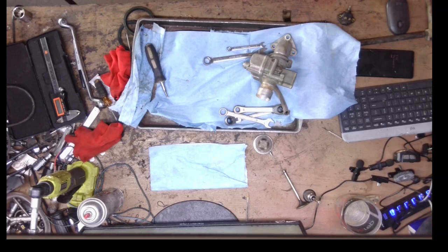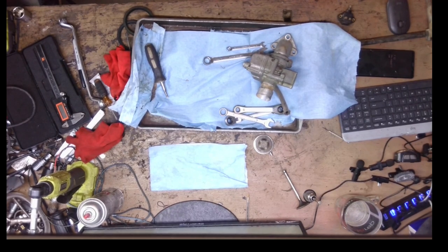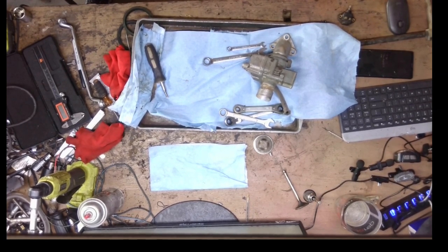Those clamps holding the intake manifold are original clamps — kind of expensive too, so it's nice that they're there. They're not the easiest to get off, but once you learn how, there's like a trick to everything. There are two circuits: a run circuit and an idle circuit. There is a main jet — two different passages for each — so we are going to make sure everything is clean so it will not only idle correctly, but when you hit the throttle it will accelerate.